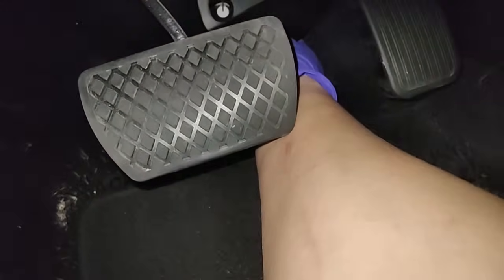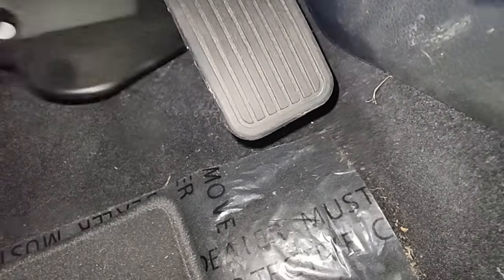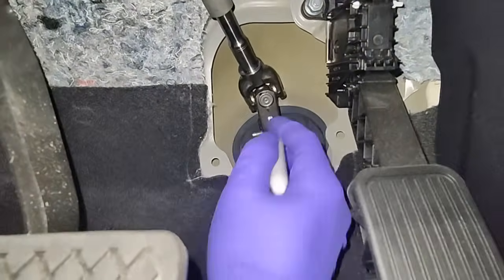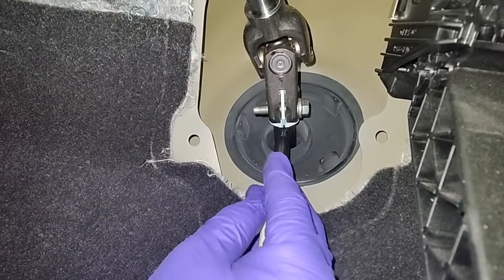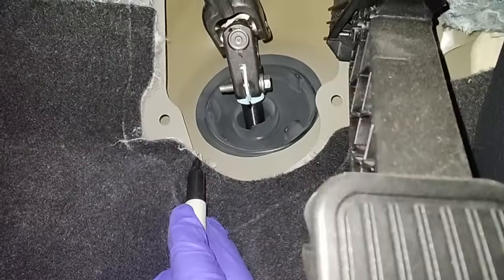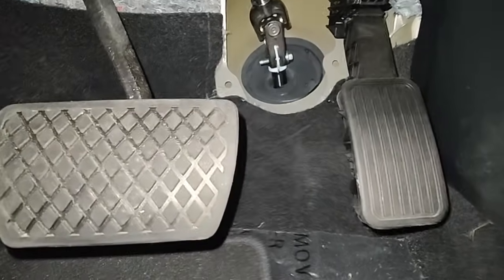This affects HRVs, Civics, and whatever else - CRV hybrids, Civic non-hybrid. Typically what I do is disconnect the steering shaft, because how they want us to do it is remove the subframe. So I mark the little sleeve on the pinion shaft - I make two lines so once I take that off, even if the sleeve moves, I'll just line it back up with the same marks on the pinion shaft.